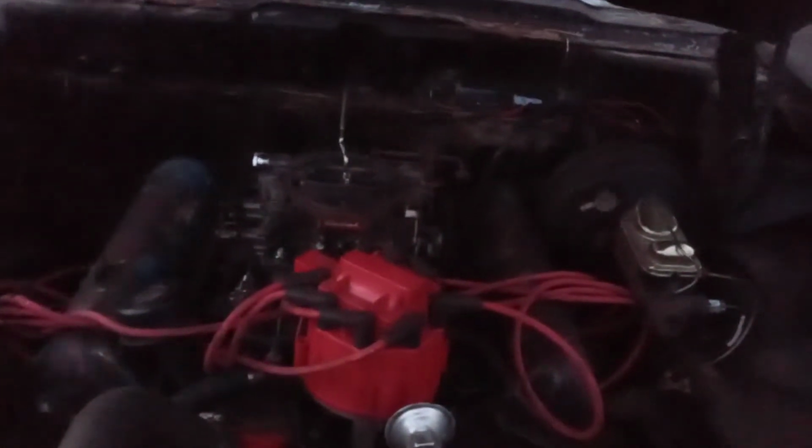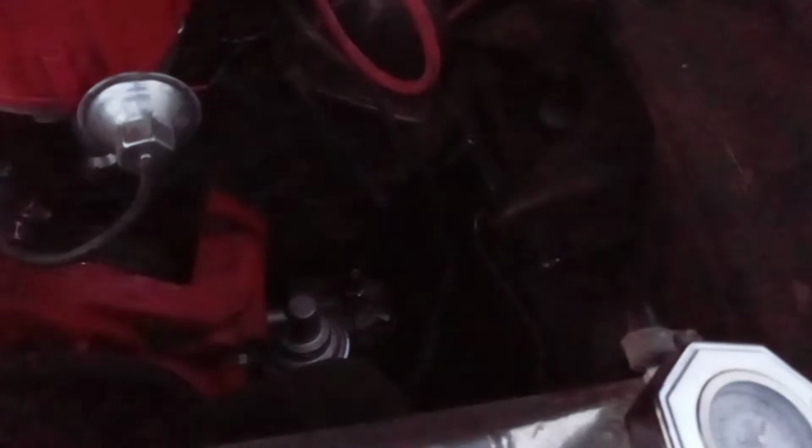It makes it nice. So anyway, we reused our original fuel pump line. We reused that a little bit. I had to tweak it just a little bit. Actually, I'm going to buy a whole other fuel line. I believe that's a 5/16 fuel line. And yeah, it's 5/16 fuel line. I'm going to rebend that and make it more professional, we'll say, because that looks kind of rough, and I'm going to straighten that up some more. But anyway, we've got a 1-wire alternator on here.